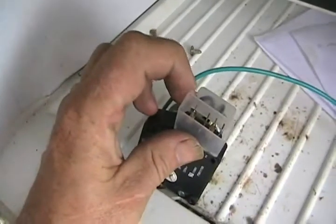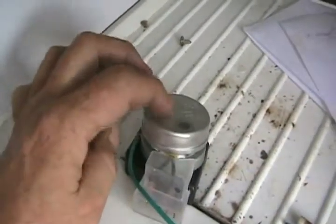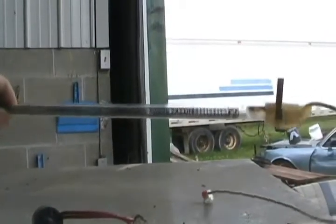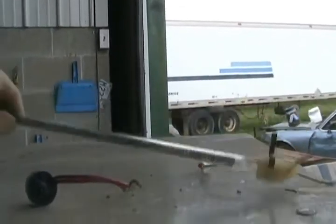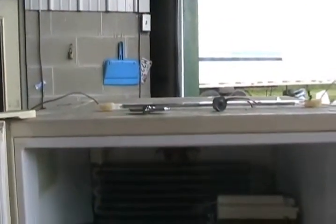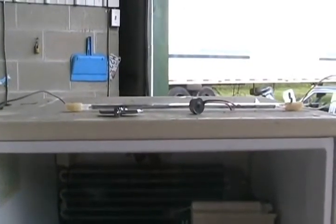You will also see a tiny blue spark, and that's happening because it's energizing the little motor, but that's just a minor blue spark. Don't pay attention to that one. These heaters have a resistance of anywhere from, say, 10 ohms to 40 ohms, and side-by-side fridges that have the freezer over there often have two shorter ones, each one about 8 inches apart. So one may be good, but the second one may be bad because they're wired in series.